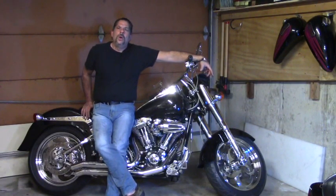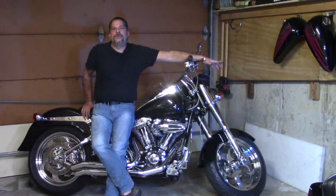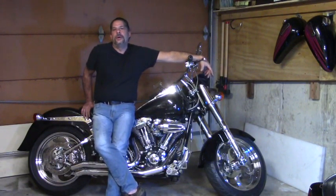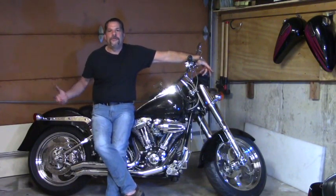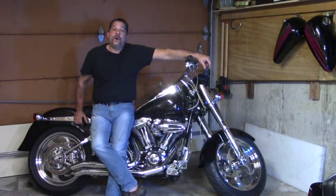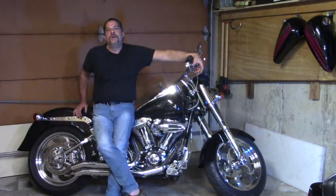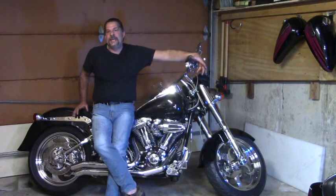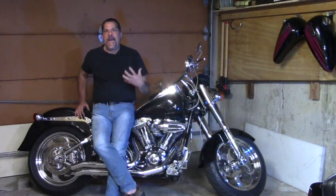One quick note, in '95, way back when now, when they first introduced the first production fuel injection motorcycle, the 32 amp system wasn't enough to properly operate the fuel pump needed for fuel injection. That's what brought on the onslaught of the 35, 38, then I believe it was the 40 or 42 amp output system. And all they really did was put a bigger magnet on the rotor itself. The stator winding typically remained the same, but the rotor shell itself got a heavier magnet.